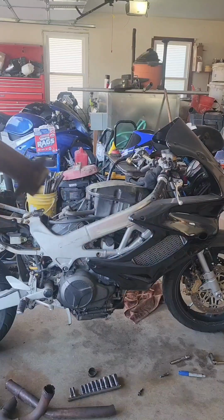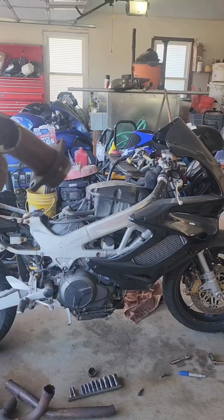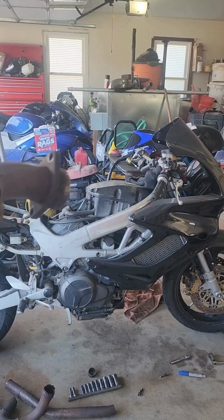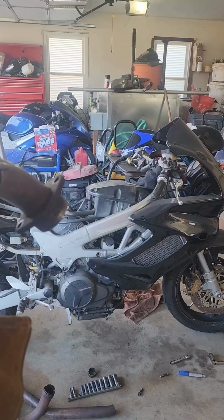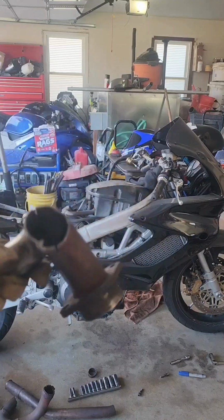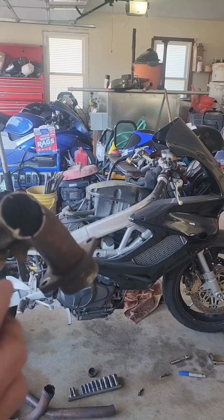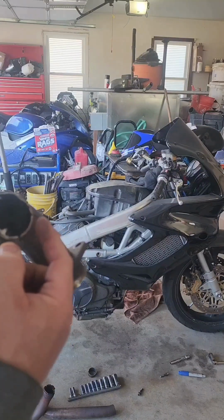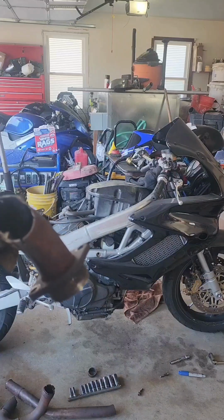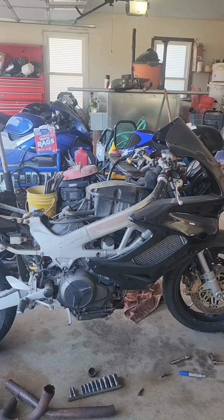All right, had a little hiccup trying to get the downpipe connected to the turbo flange. So I'm working with a round hole in the inlet flange and an oval hole on the turbo inlet pipe, sorry. So I made a couple slots, 1, 2, 3, and 4, and then I'm gonna hammer tap these oblonged edges in, trying to make it more circular to actually fit in the flange, because the problem I'm having now, it's oval and it's hitting the actual bolts that hold the flange to the turbo, so that's no good. Once I welded on there, I wouldn't have been able to get the bolts off. So did that, cut it, and now I'm gonna just hammer it down, get it into shape.